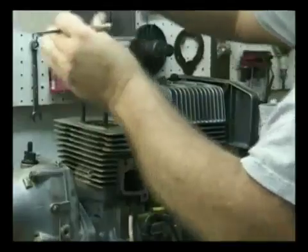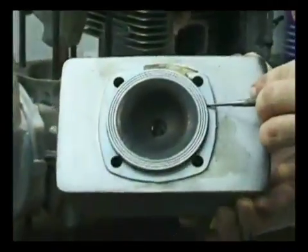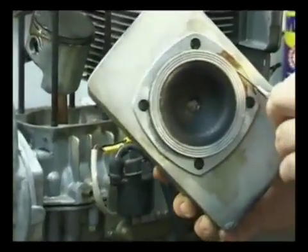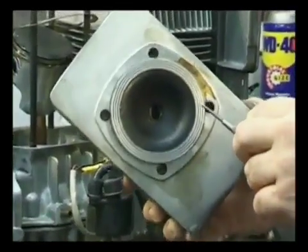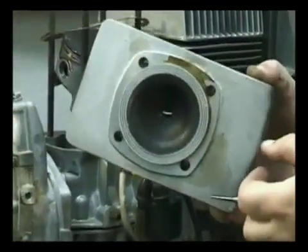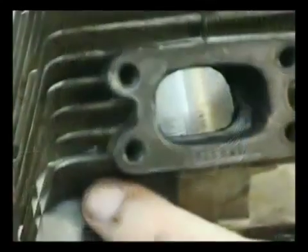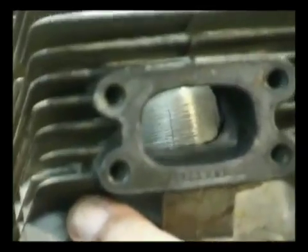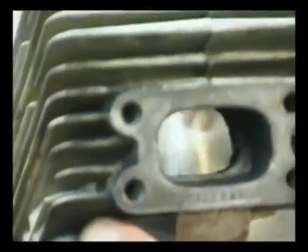The indication of a head leak — it was definitely worse on one side than the other, and it may have been caused by somebody not knowing about the tilting of the head. These are not crosshatch marks; they are just spun marks, just going around in a circle.